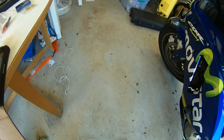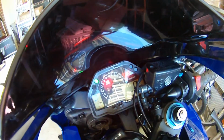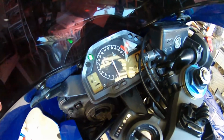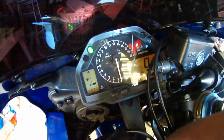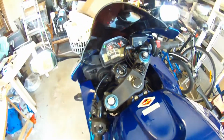Right, so now the next step from that is to disconnect the red clip of the inspection adapter of the battery terminal for around 2 seconds. Alright, let's disconnect this. 3, 4. That's exactly what we want. So basically, once we've disconnected the red terminal and reconnected after 5 seconds or more, the HISS light should flash for 4 seconds. So 1, 2, 3, 4, then it goes off, and this keeps repeating. So that means the step is correct.